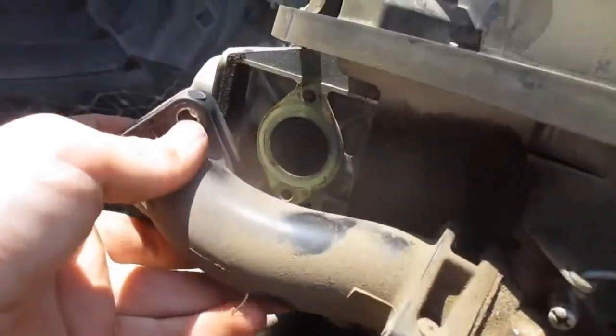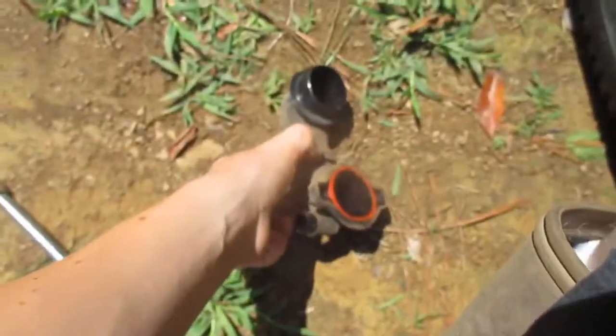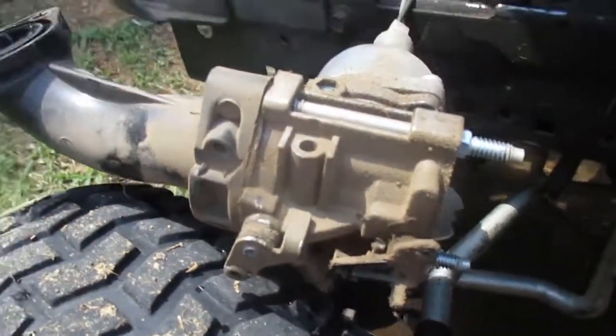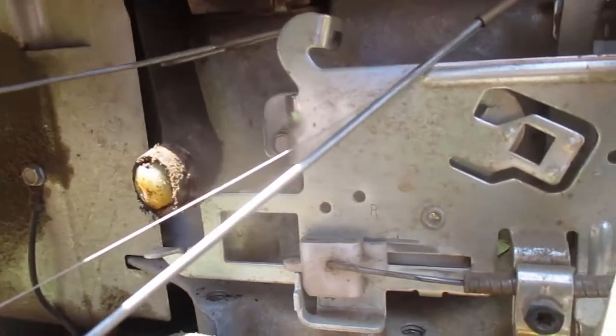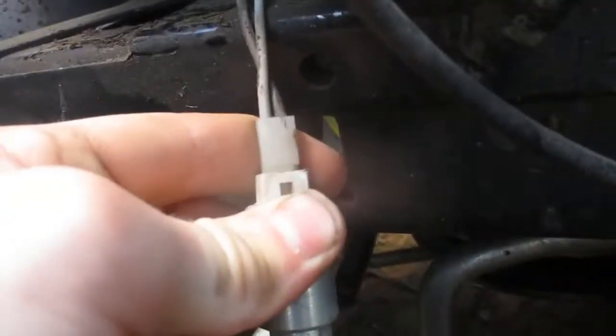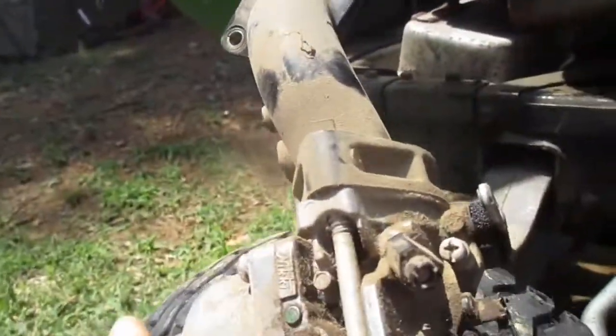Take out the nut — there's also a nut there. Behind this there was a little rubber gasket, like this one. It fell out, so keep an eye on those — also keep an eye on that one, it might fall out too. And don't mess with any of those adjustment screws; better to avoid adjusting them if you can. I just had to wiggle off the throttle linkage. The choke connection goes right there, as you can see. Make sure you know what position it's in so you can slip it back in. And here's the carburetor — we're gonna go and clean it now.